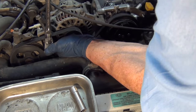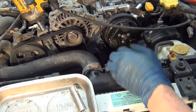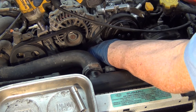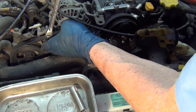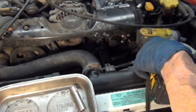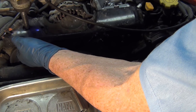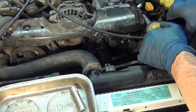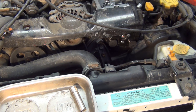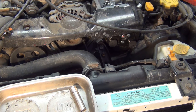Set it to tighten — pull it up to where it's close and set it just gently but not too slow. Find the longest run on this belt and right about there is perfect. If you wanted to do just the clutch, as I mentioned, we didn't need to do the whole AC compressor, but it's good to do it just because of the cost difference and labor involved. If the clutch is worn out, the compressor is probably worn out too, because every time that clutch has been engaged the compressor has been engaged as well. Half the time the compressor's bad, the other half it's the clutch, so if you've worn that one out it's best to just replace the whole thing.